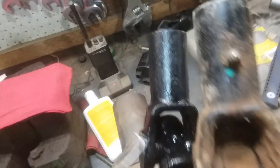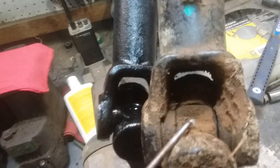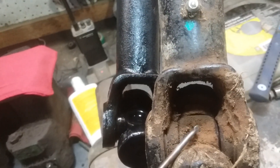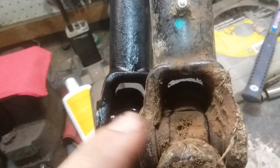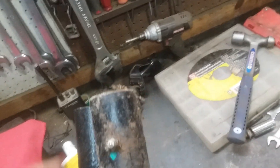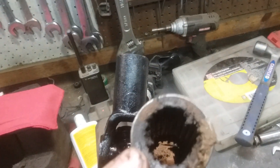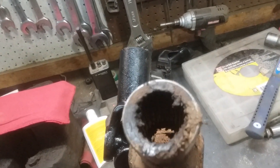So anyway, just wanted to point that out on these Polaris drive shafts. If you've got a U-joint issue, I think you might be better off just putting the P338 U-joint in here with a grease zerk, keeping it greased, and make sure you keep this yoke greased because there is nothing to keep water from getting in there and starting some rust issues.